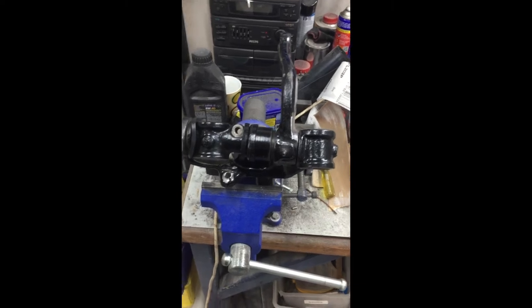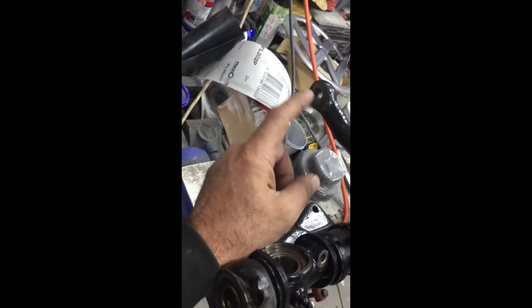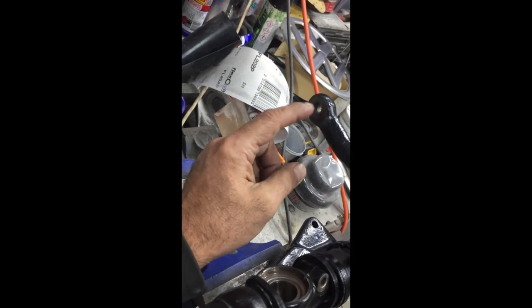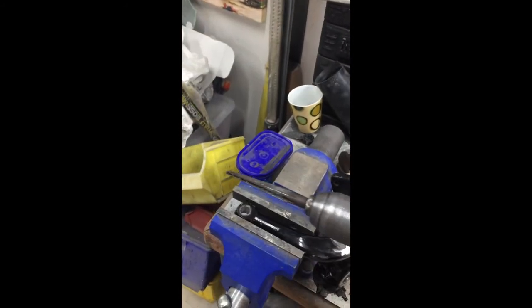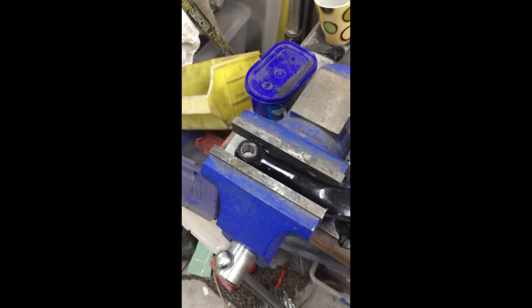The second last thing we've got to do is we have to ream this, and you need a reamer. I think the bay window one is used here because this is tapered, and because the tie rod arms are going to be flipped for extra clearance, you have to ream this the other way - it's a cone shape obviously inside that. Got the tie rod hole reamed out. I just used the drill, popped it in nice and slow, and also have the clutch on so that it doesn't grab and doesn't snap your freaking reamer - which again, they cost a lot of money.